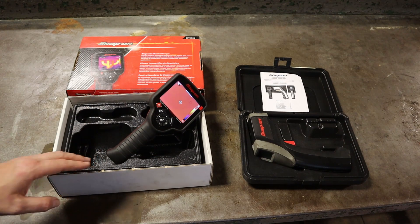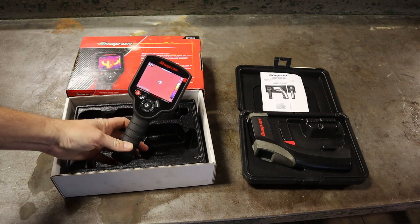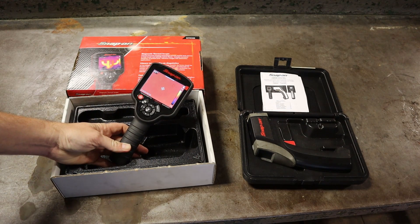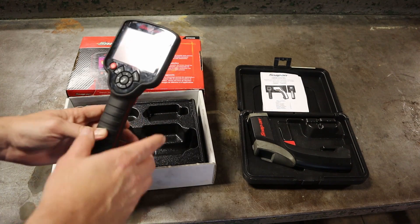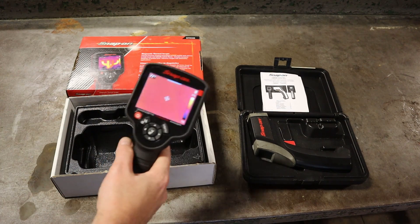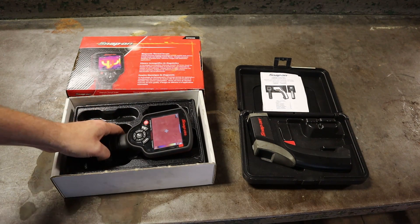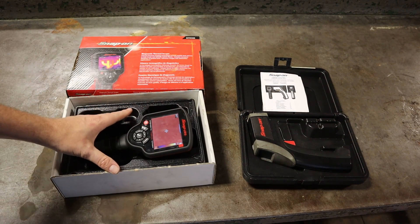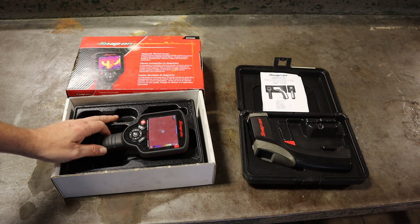If it's summer outside and you don't feel like sitting in both seats to see if they're working, you can fire this up and point it at the seats, turn the heated seats on, heated mirrors, heated back glass — the grid on the back of the glass. This is really good at giving you a good visual picture of catalytic converters, diagnosing the in and out temperatures of catalytic converters. This is just perfect for that.